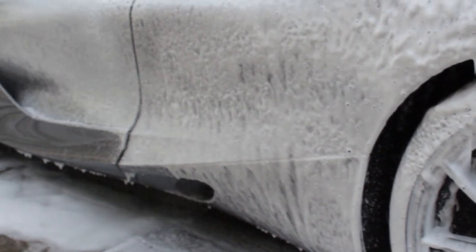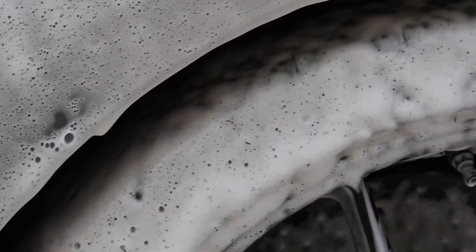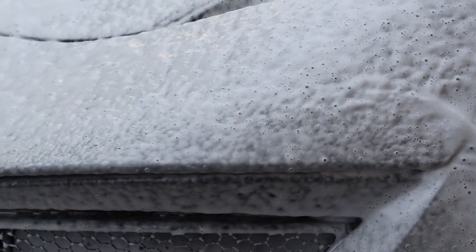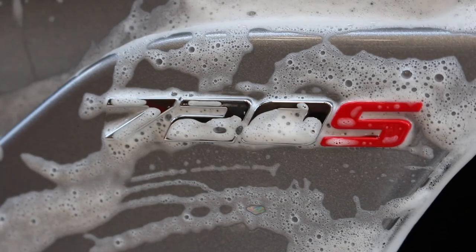You have to kind of adhere to that system of least to most aggressive. And when you can catch that you're no longer getting progress from your least aggressive step, then you go to the next aggressive step. For some situations that might be a clay bar, for some situations that might be go to polish. But even when you're going up a step and going more aggressive, that's better than staying stuck in a least aggressive step and going too far, where you actually start adding too much friction, too much damage, and you're getting no results still. You're just damaging the paint surrounding what you're trying to fix, which might be a bug thing or a bird poop thing, or even a piece of rubber. It's extremely important that you maintain a level of least to most aggressive and know when to move to the next step.